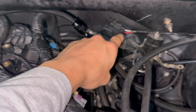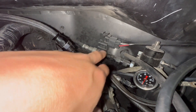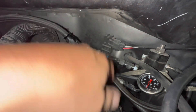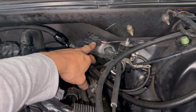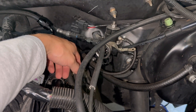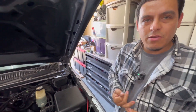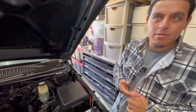Now if you do want to run a flex fuel sensor, it's going to be the exact same setup, just now you're adding your sensor and your wiring. This is the sensor here. In my case it's funny — I'm not even on a 91 tune right now, so I might not even end up using it, but I have it there just in case. When you get your sensor, you'll also need to buy the harness separately. My sensor is the AC Delco — I'll have the link in the description. For the wiring, you've got three wires: constant battery power, ground, and the wire that goes into your computer or ECU, which should be pin 56 on the blue connector.